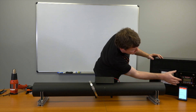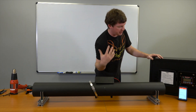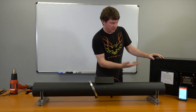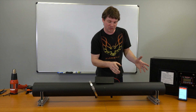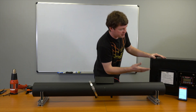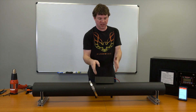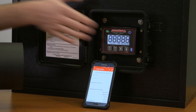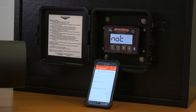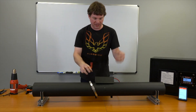When I cycle the power on the gauge, it's showing me this frozen number. Every time you turn the gauge on it re-scans for sensors — it asks how many sensors are there, one, two, or three, and checks whether that matches what it expects. In this case it's going to find the one that's working and not find this one, so it's going to say there's a problem. And it's going to say 'sensor one not found.'